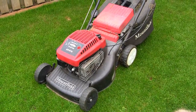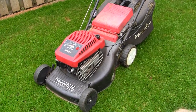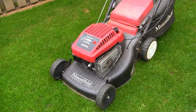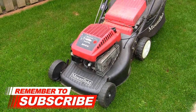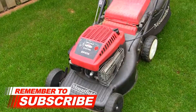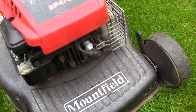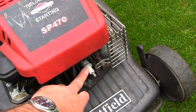One of the top 10 questions I get asked on the YouTube channel is which way is the correct way to tip a petrol lawnmower up, and I always reply with the same answer: why do you need to tip it up? Nine times out of ten it's because they want to change the oil. There's absolutely no need to tip a lawnmower up unless you're changing the blade or taking grass off the deck underneath. If you are planning on working underneath any lawnmower, the best thing to do first is remove the lead and completely remove the spark plug.